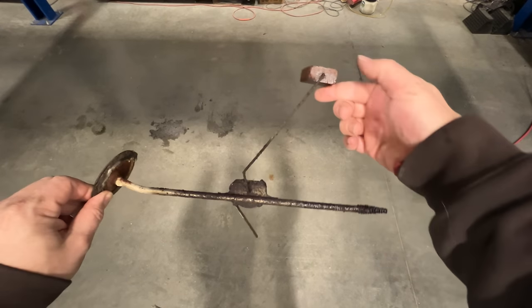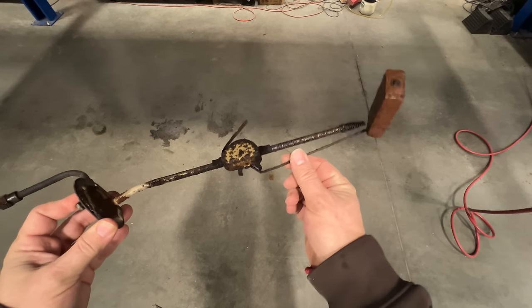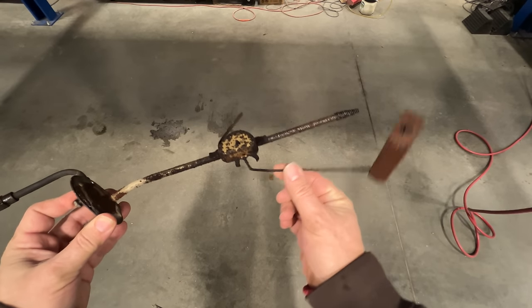Here's the sender that came out of it — the float still does move. Looks like the wire that went to it is completely corroded, so the fuel gauge will not be working. I'm going to take my blow gun and try to blow through it again to verify that this is clogged up. I can hear some air coming through but hardly any, so this tube is definitely clogged up. Since the fuel sender looked that bad, I'm going to take the drain plug out of the bottom of the fuel tank and drain it as well. Looks like this must have had a full tank of fuel in it.